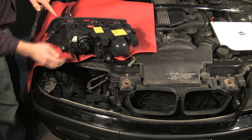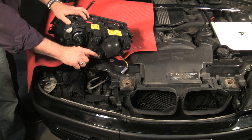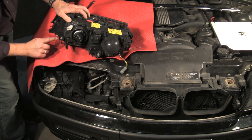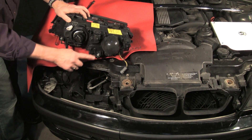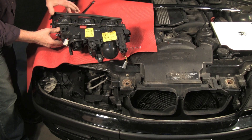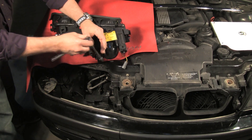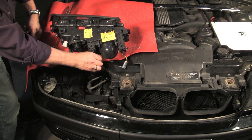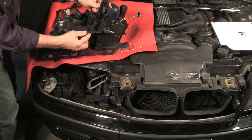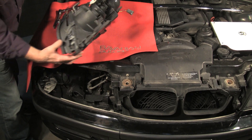Now this headlight has a mounting bracket on it. This is the screw we removed from behind, and this is the one we removed from right down here. You can see on the bracket there's this one and inboard is this one. We could remove this bracket and install the whole thing with the bracket, but it's easier just to remove the bracket from the headlight and use the original bracket. Some of the cars will have 8mm screws back here, so it will be either 8 or 10. Now we can simply pull the bracket off — and this would be a discard.